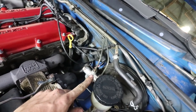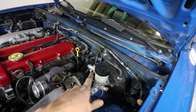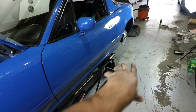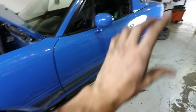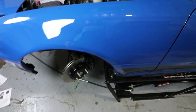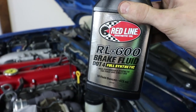I'd try reflaring the end of this brake line — I might have to replace the entire brake line, I might not, I don't know. But I don't want to go through that hassle right now, so we're going to try to run these brakes without the proportioning valve. The proportioning valve allows you to adjust front and rear brake bias, and without it we might have too much power going to the front or rear brakes, causing wheels to lock up too quickly. But maybe we're lucky and the bias is really perfect where we don't need to adjust it.